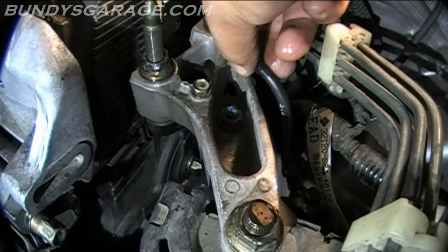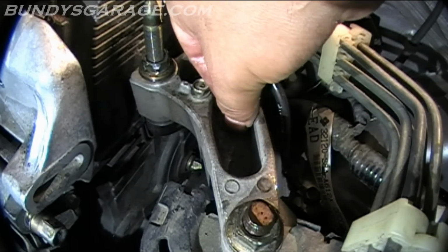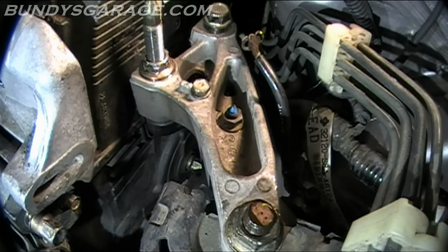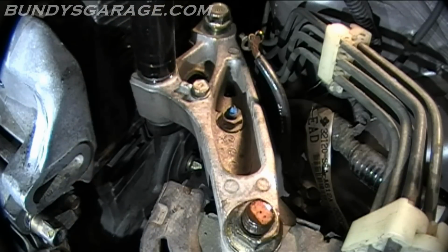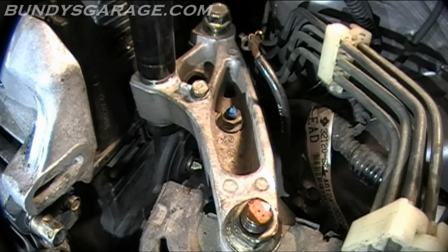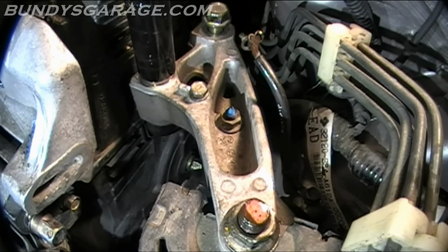And right here's your grounding cable. Don't forget that. Actually, I'll adjust this down first. This is actually the lock that holds the bracket down onto the engine mount. Oh yeah, that one has plenty of clearance. I'm going to run all these bolts down. 17 millimeter, using a half-inch ratchet with a 17 millimeter impact socket. So I'm going to make this one snug, and I'll go around counterclockwise and tighten it this way.